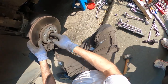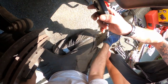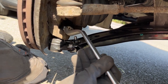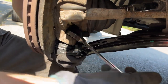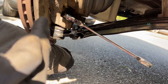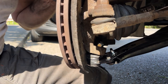Steering corrected to straight ahead - it's just too difficult to get the spline hub in without moving it straight ahead. I'm sure it's solidly on. Now we get the new hub nut on - just finger tight. You're supposed to torque this up to 20 newton metres plus 90 degrees. Unfortunately it's virtually impossible to get a torque wrench in to that point, so I'm going to do it by feel to what feels like about 20 newton metres and then give it 90 degrees. You can see it pulling that ball joint through, which is great. That feels like about 20 newton metres, now a full 90 degrees on top - that's about 60 degrees to the side of the vehicle, so two thirds, then another third.